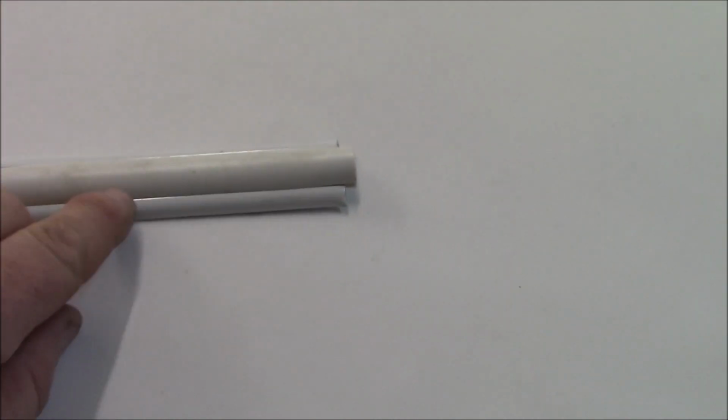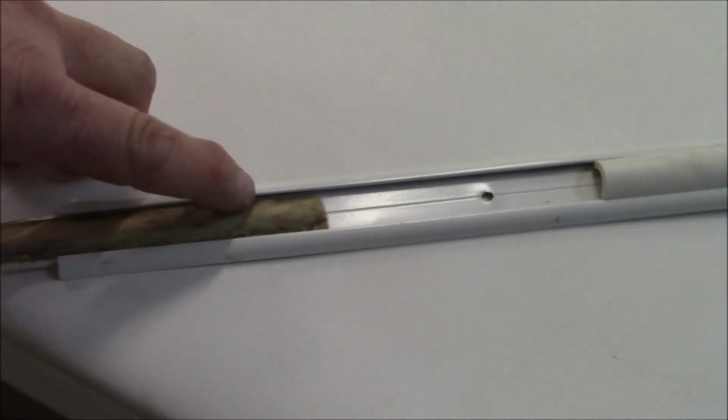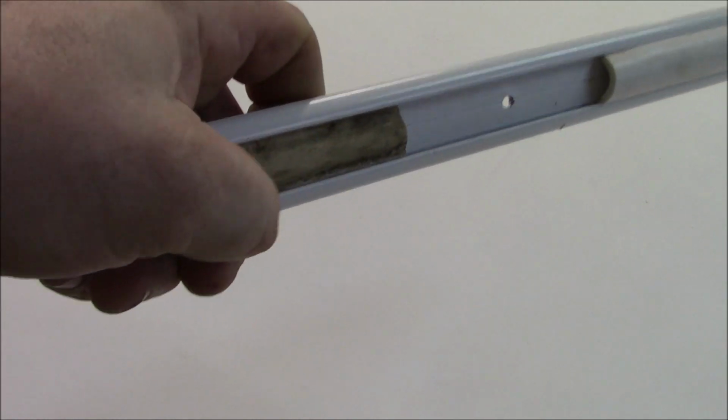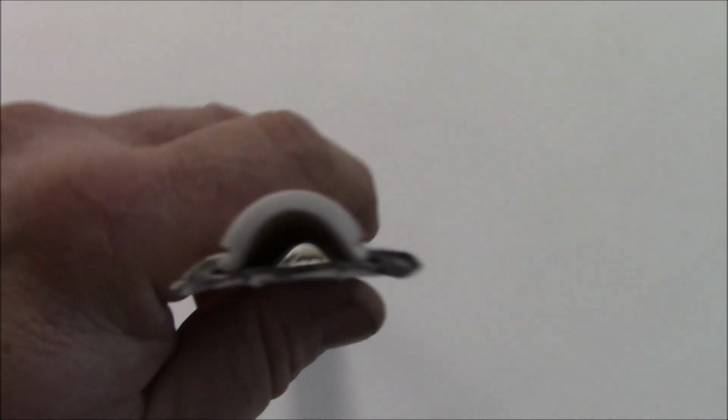And now I'll show you the insert trim we put in. This is what comes from the factory, okay? This is your typical RV junk. And what happens with this one, you can see on here how it just slides in that track. So now that it's sitting up like this, you'll get water down on this side and it'll trickle all down inside that track. What we use is this.